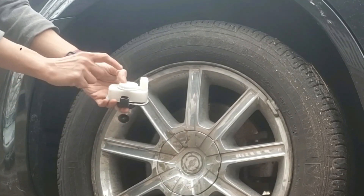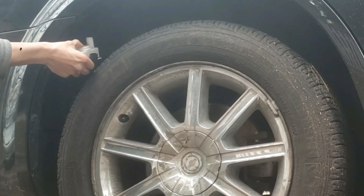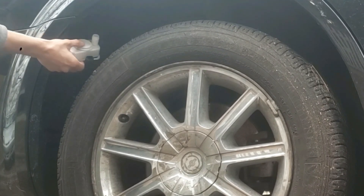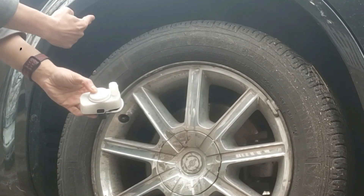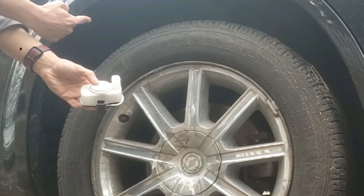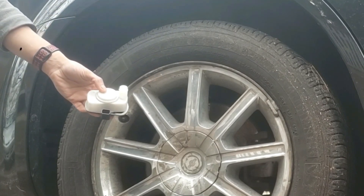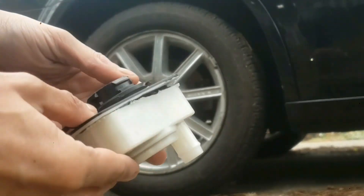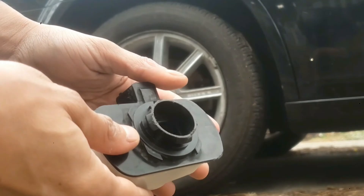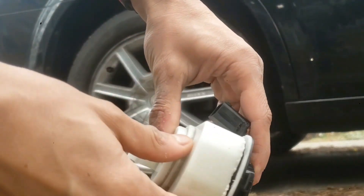This ESIM, or leak detection pump, sits right on top of the EVAP canister, located near the right rear passenger tire. It is meant to be a sealed piece so no harmful pollutants escape into the atmosphere. Cars from the 2000s and up all have these. As more people transition to electric cars, these will become obsolete, and the emission folks will be out of a job — though I'm sure they'll come up with some new scheme for electric cars.